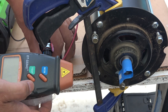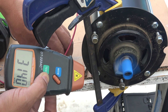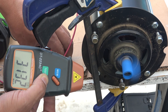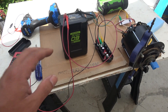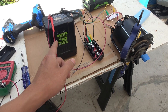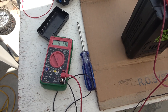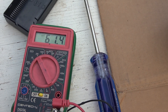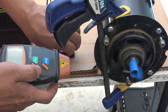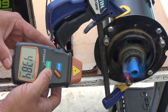Let's see how many RPM we get from this motor — 3,130 RPM. I wanted to see the maximum RPM I can get out of this controller, so I've got my 60-volt battery connected, and the battery is full, right now at 61.4 volts. About 4,380 RPM.